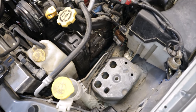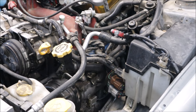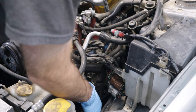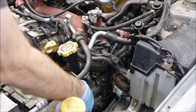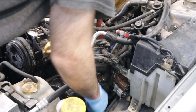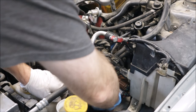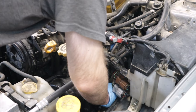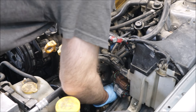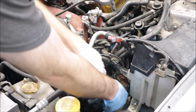That's pretty clean — I don't see any rust, just a bunch of dirt. 12 millimeter to loosen and remove the coil. There it is. One little clickety-clack at a time. Remove the coil, pull it out — it'll hit the frame rail, so you twist it a certain amount of degrees and then pull it out.